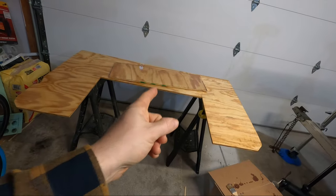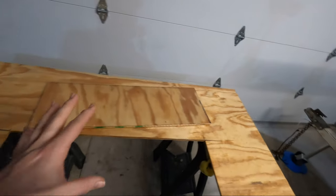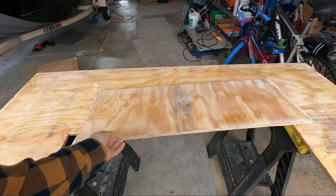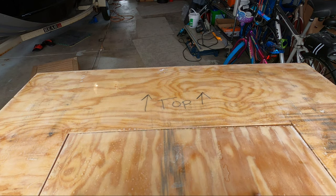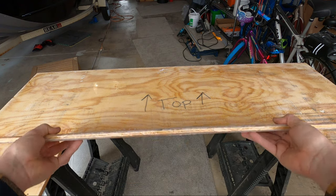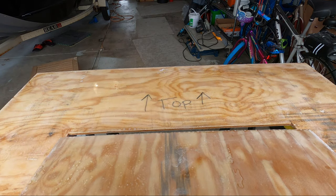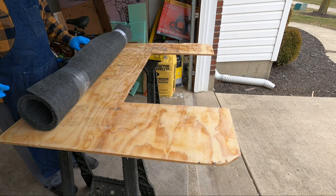The next step is to get these pieces of wood carpeted. I'm going to fully sand down and get it prepped for carpet glue. That finished up the back deck sanding — all the high spots are knocked down on the edges. Let's just make sure it still fits into place. Still matches up. There's a little bit of side-to-side room to account for the carpet. Moves up well, no clearance issues. The underside is nice and glossy still. Let's go ahead and get our carpet cut to size.